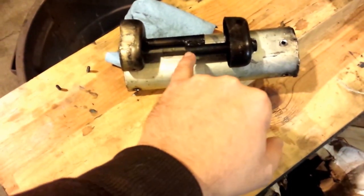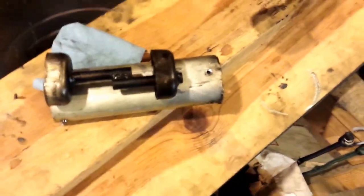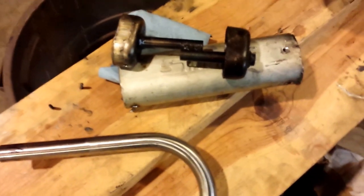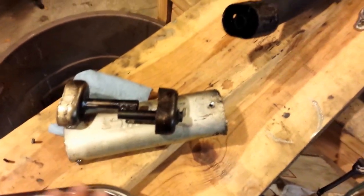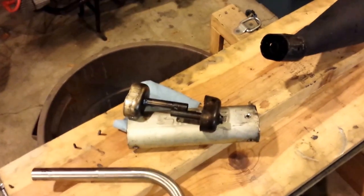In the baffle I've got these two tubes — this functions as the silencer — these are 9 millimeters internal diameter. So what I'm gonna do is cut this apart, take these guys out, and redo the silencer using this stuff, which is about 16.85 millimeters. Reading Graham Bell's two-stroke tuning book, he said the silencer should be slightly bigger than the stinger, and 16.85 is definitely slightly bigger than 13.